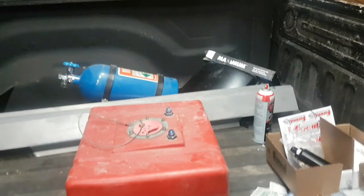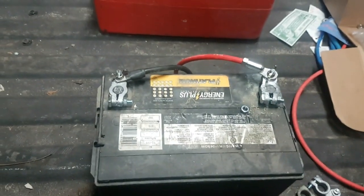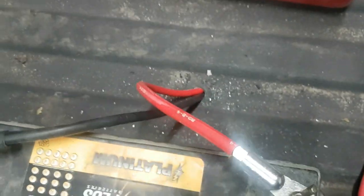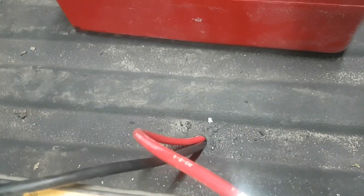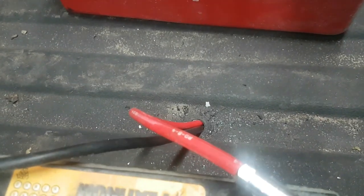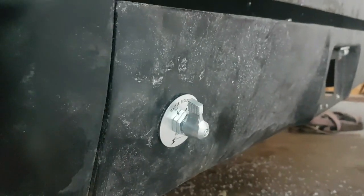So in the bed we've got our battery cables run for our battery. We haven't got it tied down yet — we are getting a tray. You can see right there we've got a hole going down through. We are going to put a grommet around the hole, because you never want to put battery cables through a bare hole like that — you risk the wires rubbing on the box and you will end up shorting out eventually. We put a disconnect in just in case anything does go wrong when we're on the track so we will be able to quickly turn it off.